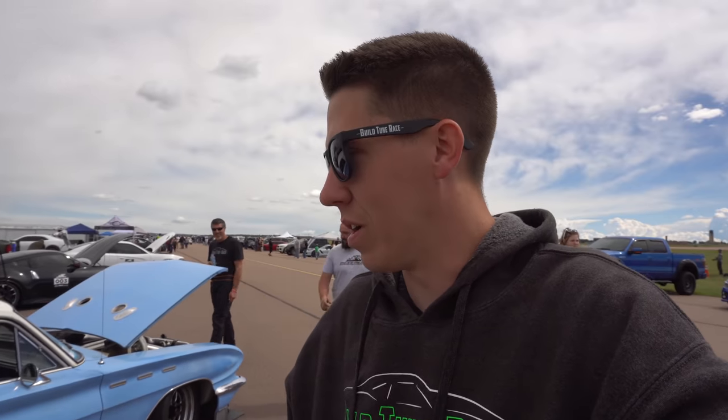So I just got done putting the tune in Project 200 to hopefully go 200. 30 pounds of boost, leaned it out just a hair, smoothed out the timing pull, so hopefully it takes off and doesn't cough and hiccup on the hit, because if you can gain a little up top, just like a 60 foot, it helps you out dramatically up top. So if we can gain a mile an hour down here, the 2 extra pounds of boost gains us 2 up there, 199, 200. So we're going to try it now and see what happens.